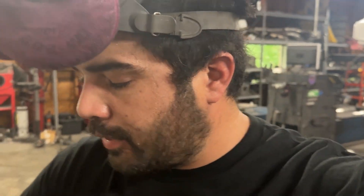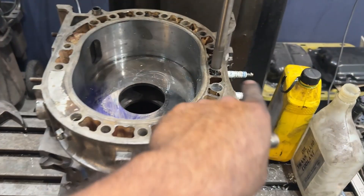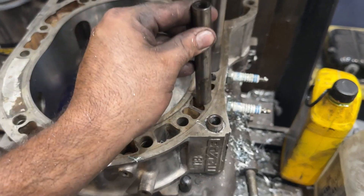I got this port pretty much almost done, runners polished up, so I have to work on the middle plate and the rear plate, which are right here. Then all three of those plates are going to get powder coated. The housings are peripheral port — semi-peripheral — so after I port this we're going to put it on the end mill and drill for the dowel pins.